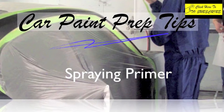Like I mentioned, I don't like putting the little squares around the repair areas. If that is a method that you use, be sure and do the back masking and try not to prime all the way to the edge.